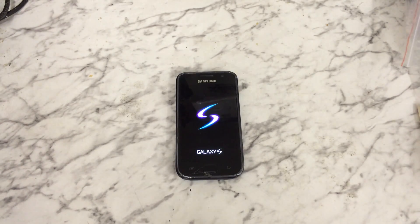The phone is now rebooting. Depending on how much you had on there, it might take a few minutes. Like I said, this is useful if you just want to do a hard reset because the phone's messing about with software, or if you've got a pattern lock or passcode you can't remember, or your kids got in and changed it. This bypasses that, and when the phone starts up it'll be back to its factory settings, just like how you bought it.